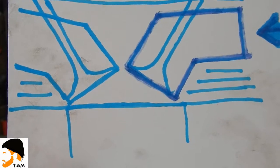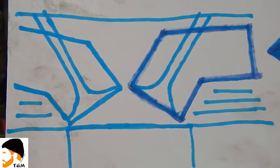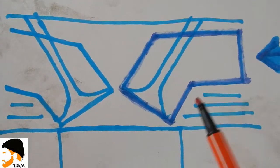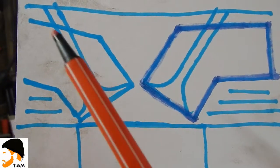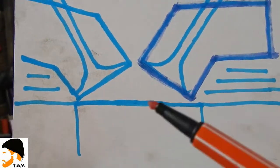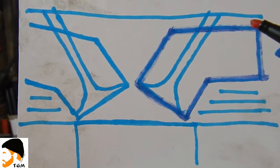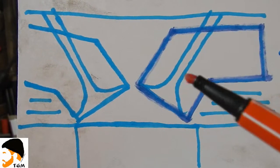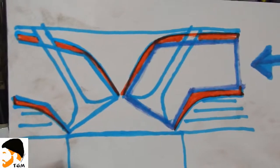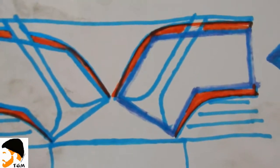I thought I'd take this opportunity to explain a little bit more about what we're doing with the porting. It's easier for me to draw a very crude drawing to make things easier to understand. Essentially stock ports are very angular inside and the casting is very rough. What we want to do — this is meant to be the valves, top of the cylinder, and down into the bore — is smooth these out and also increase the size of the porting. Where I've marked in red is essentially where we've taken material out of the cylinder head, smoothing the flow going through the ports.